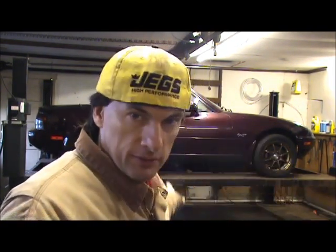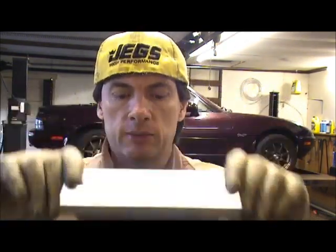Remember that I'm not positive on these numbers, but I do believe that I got a 2-degree pinion angle on the rear end and a 2-degree pinion angle on the transmission, so in total it's 4 degrees. That's all in Martin's book, the Monster Miata book. It tells you what your pinion angle is supposed to be. Anyways, this was all figured out a long time ago. But that's where that plate comes in, because the pinion angle has to be correct or else you'll get a vibration.